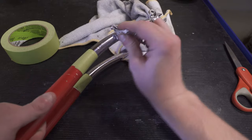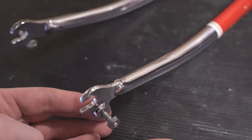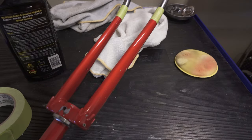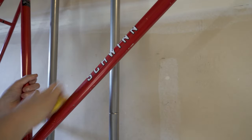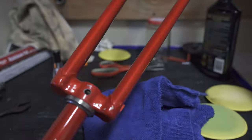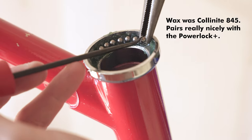The forks are kind of fun because they've got this two-tone paint with bare chrome — I love it. So I cleaned that chrome up and then decided to go ahead and polish, seal, and wax the whole bike. The steps are: a compound polisher, then a fine polishing — even that alone removes the oxidation from the paint and brings a ton of shine back. I decided to leave the original decals. Then you throw a sealer on there and the paint has depth, gloss, and protection. I also did a wax just for extra protection.